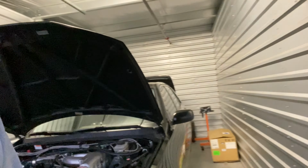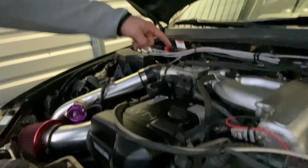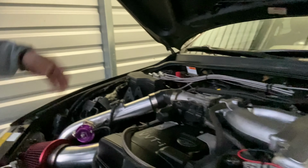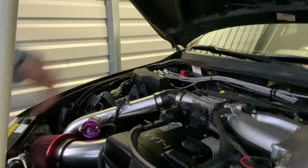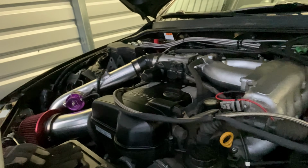I got to get the engine on that jack stand there, get the hood off. Some of those things take a second person, so I'm sure Sean will come over and help me at some point, and we'll get this thing going. And then basically it's going to turn to taking the intake off, getting all this out of the way, taking the turbo back off, exhaust, get the head pulled, and we'll see if there's anything visible at that point.